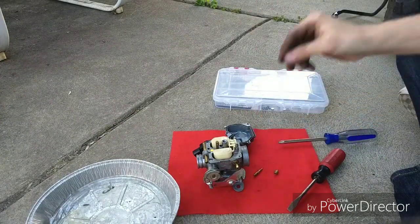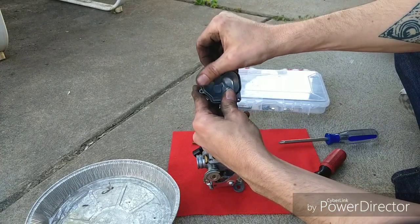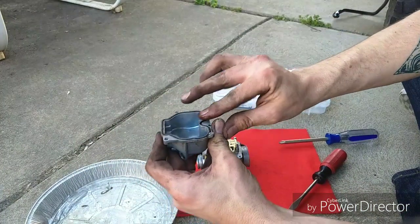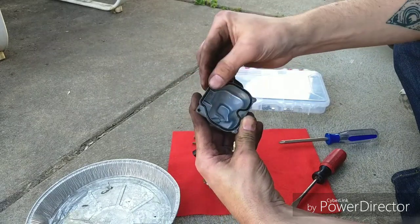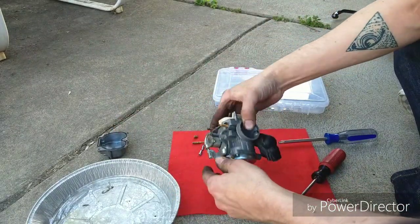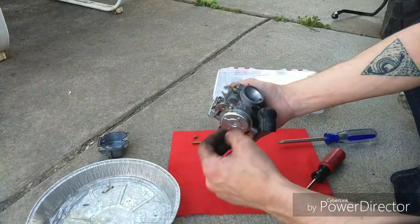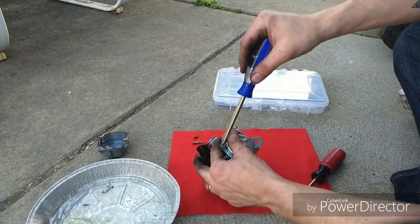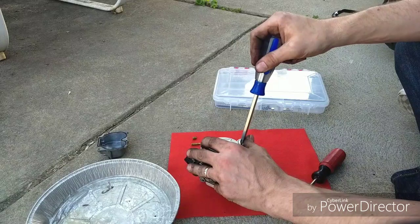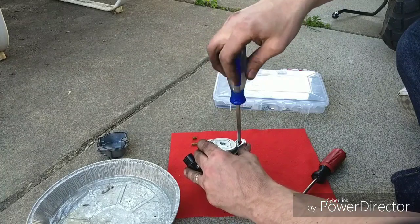I'm going to get something to clean that out later. The needle does look a little bit dry, so I'm not going to risk pulling it this time since I don't have a replacement — just clean it off a little bit and we'll look into getting a replacement. I'm going to pull the diaphragm as well because I want to spray the whole thing with carb cleaner and I don't want any rubber on the carb. If you're just rejetting for an intake and not cleaning the carb, you can ignore this middle section.